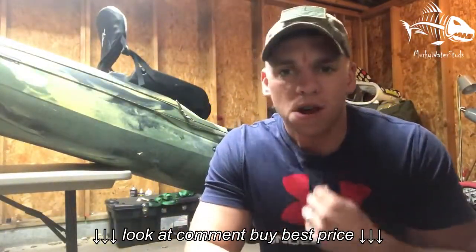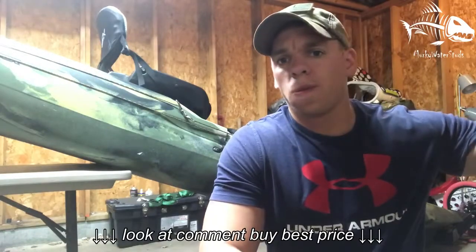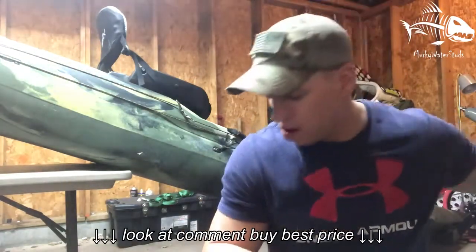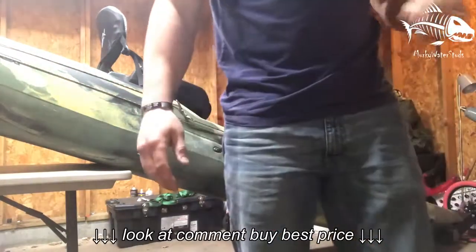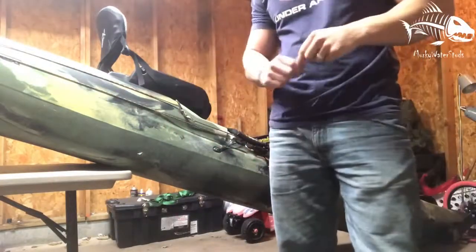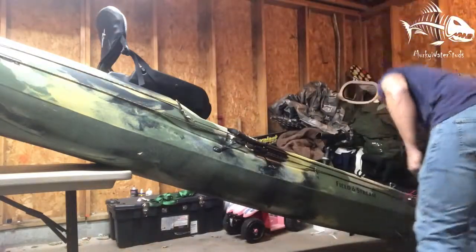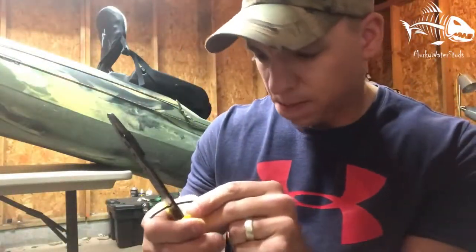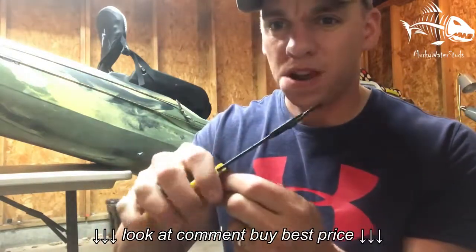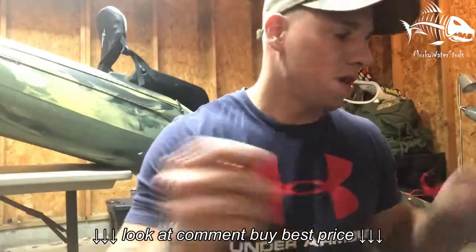All right, everybody, I'm going to show you guys how I'm putting these wires together. What I did is I just measured out the wire. Right now I measured out where it is. I measured out my negative for this other light on the other side. So what I'm going to do now is take it, it's just 18 gauge. Put the 18 gauge in, give me a little bit of space. Pop it. This is on the wire itself.